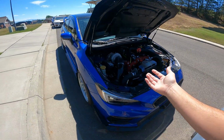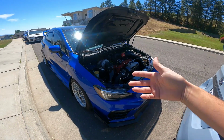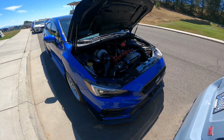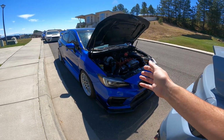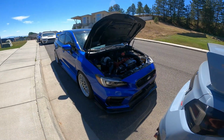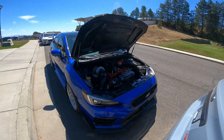I did push the limits like I told you guys, and I told JR, at the end of the day, these studs really are rated for right around 500, 600, if you want to really push it. But the car made 576, I believe it was. I'd have to look at the graph. It's either 576 or 586 on 30 pounds, and definitely some good power on there for that 6466.